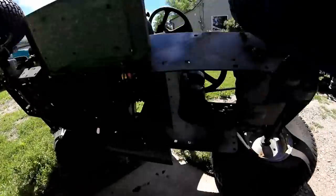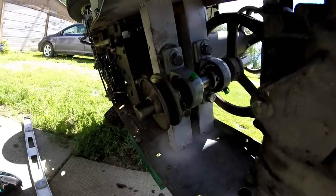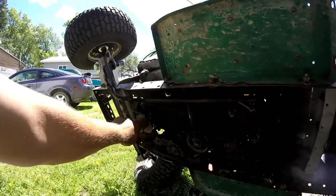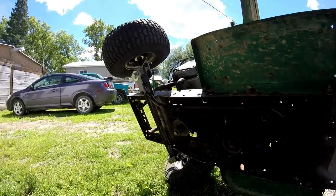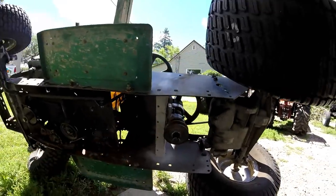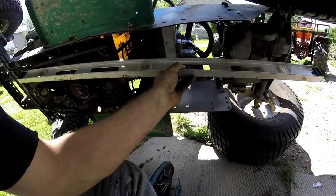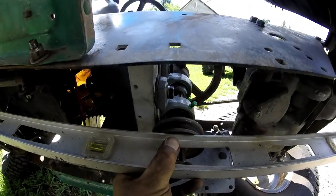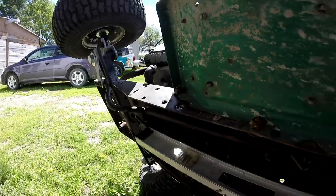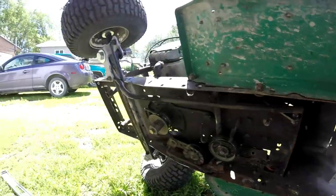Hey guys, I got a 3-inch pulley here. A deep groove, the belt will ride deep in there. And it's the same, it's a 3-inch too, I measured it. So at a 1-to-1 ratio down here. And how I align them, you get your trusty level. You put it right against the pulley, and you look on this side, it goes right against that pulley. Make sure it's touching on both sides. That's how I align them, and they are perfect.